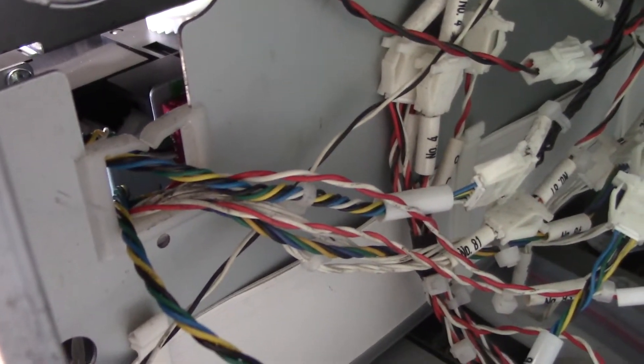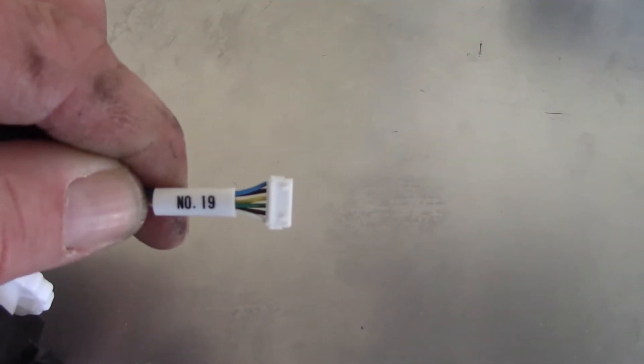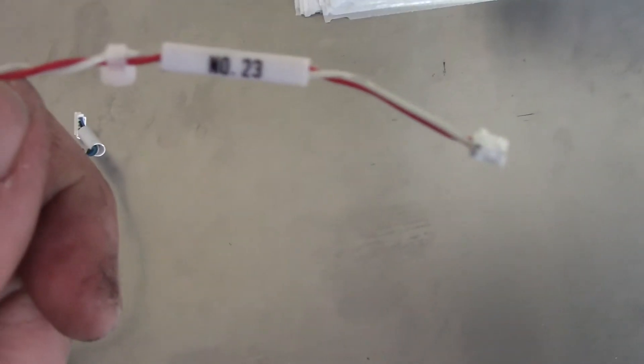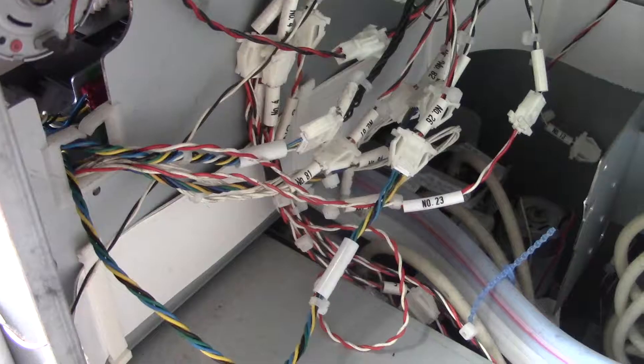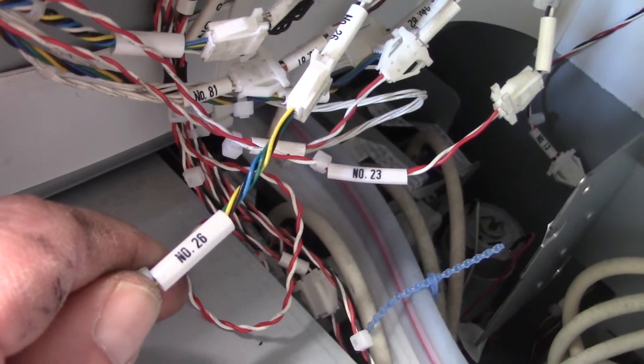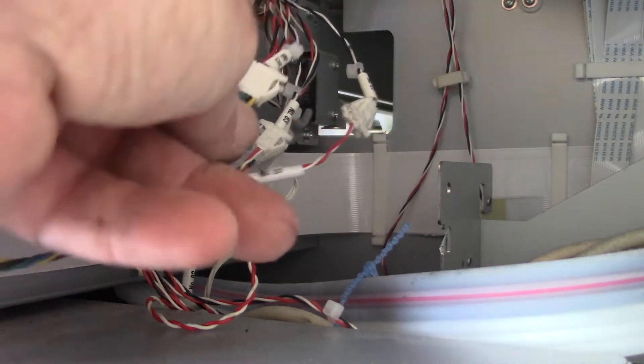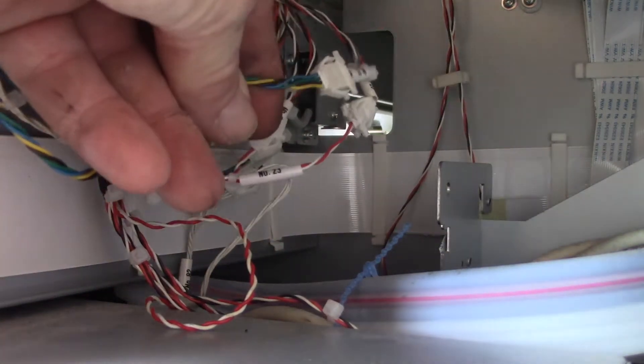You'll see the wires running through this slot located in the back. Each wire is numbered and the three wires will be 19, 23, and 26. Find the three numbered cables in the back and disconnect them by pinching the sides of the white connectors and separating the cable to the maintenance assembly from one side of the connector. I like to use small pliers for more leverage and pinch ever so softly as to not break the connector, and pull the wires apart.